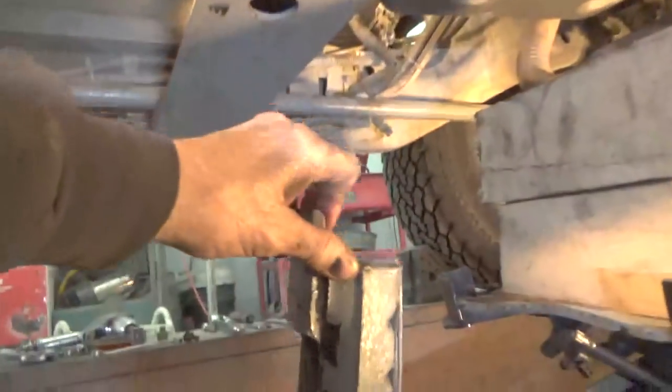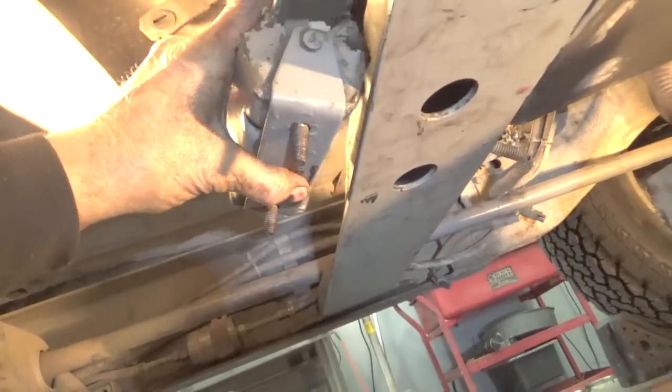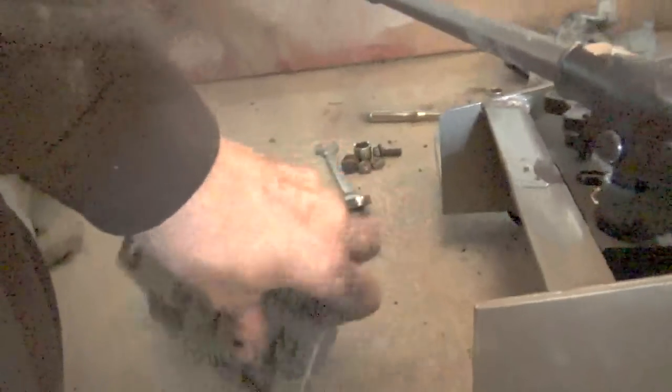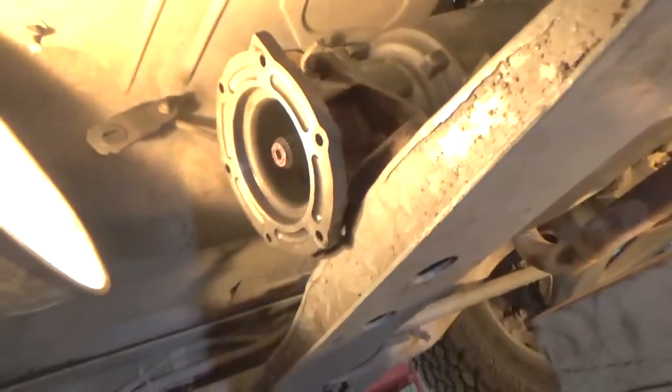The mounting block here for the transmission. So this actually bolts onto the bottom of the transfer, or the adapter for the transfer case, and then rests in, and you put the nuts on from the bottom here. Now, the one thing, because I have these apart here, you don't want to go tightening all this stuff up. You can tighten the bolts that go from this mounting bracket if you have to to the transmission, but to the adapter, I really wouldn't do that. To the adapter, I just put everything together sort of loosely.